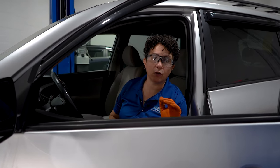What I want to do is pump the brakes up without the engine running — that pedal travels a little and it's firm. Now I'll start it up. If you have brake issues and don't know what they are, this is a good way to test that the brake booster is working: firm pedal, start the car, and the pedal should travel down once vacuum gets to the booster. This car hasn't been running for a couple of weeks, so I'll let it reach idle tone and pump the brakes — I should be really happy with them.